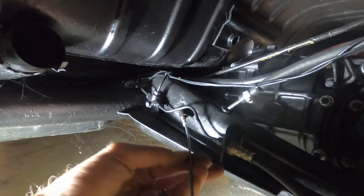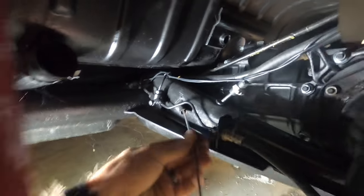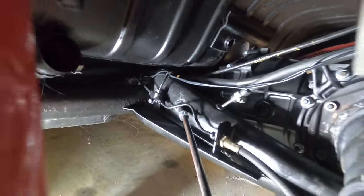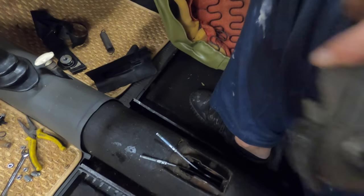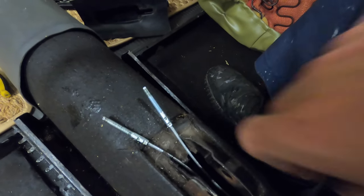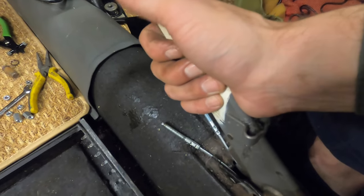You're gonna push the new one in. When you're feeding this sucker in, just make sure you don't push too hard — if there's resistance, go in there and check to see if there's anything going on. Make sure that it's catching on the lip on the floor, and also make sure the brake cables are out of the way when you're pushing it down.